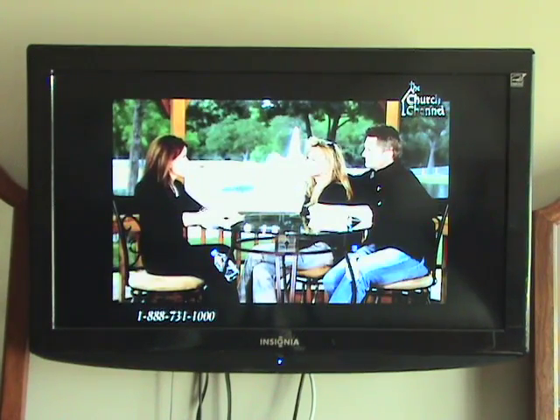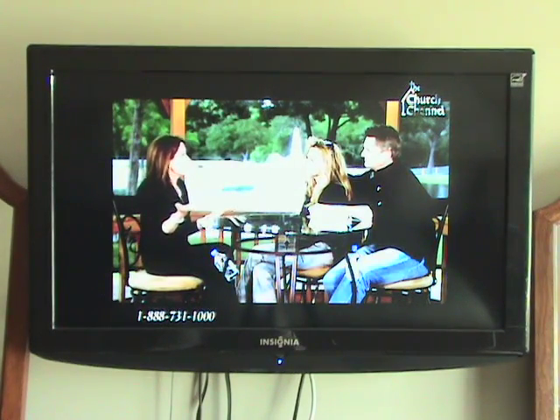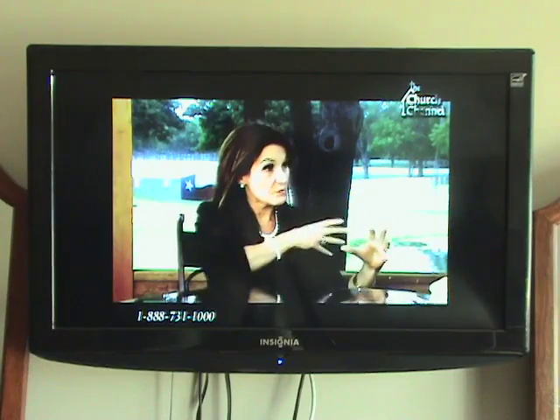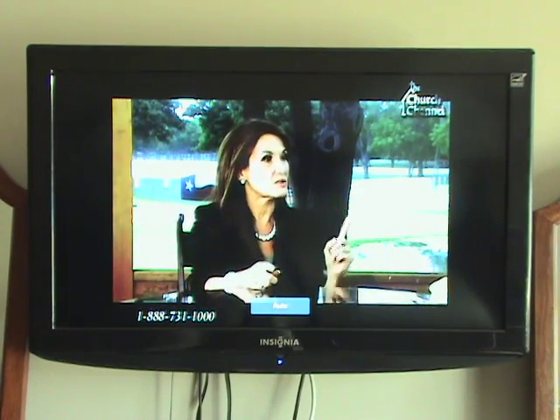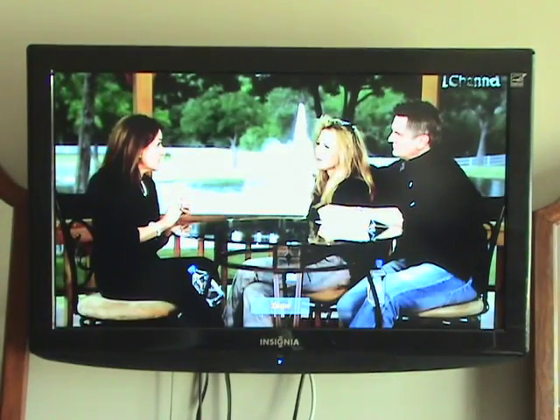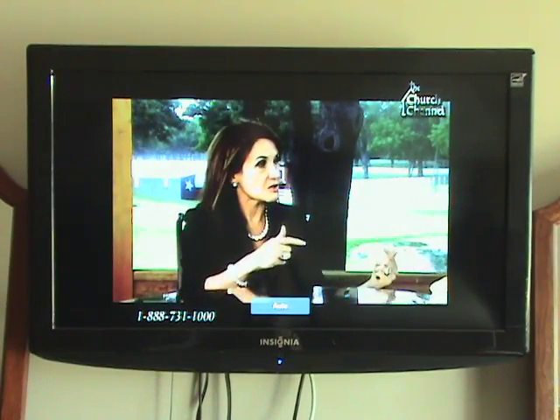Here's a channel which is broadcasting in 480i — 480 lines of resolution. But what they're doing is making their picture seem like it's a widescreen picture because it's cropped on the top and bottom, so it's wider than it is high — it's not square. It's more of a 16:9 or HD format look to it. So if I try some of these zoom positions, let's see what happens. Here's zoom — it fills the screen but we're losing a lot of the graphics information which they have outside of their picture area. So the only real way to see this channel correctly would be in the auto mode.